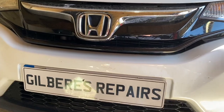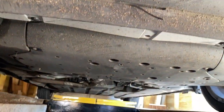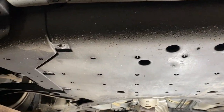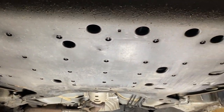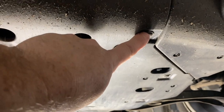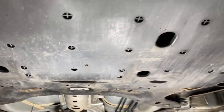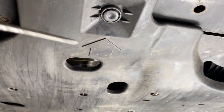Firstly we've got to get down under the car and take the belly pan off in order to get the gearbox oil out. So we get down underneath and this is what we see — we're after this one. We've got to get this belly pan off. It's very basic. There's screws around it and a couple of poppers at the back, and it just slides out towards the rear. There's the two poppers at the back of the pan.